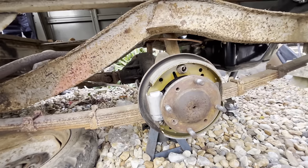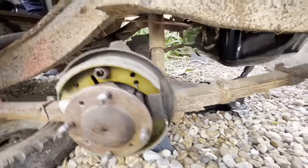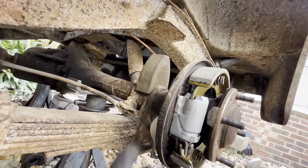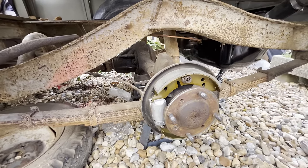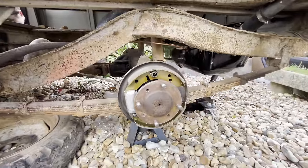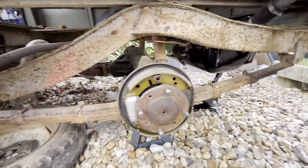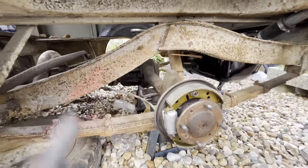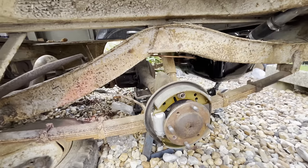So that's rear near side set up back on. Springs in behind. Just got to put the handbrake linkage back on there - it pulls on that. This is all nice and free which is good. That just slots in - I had to tap it in with a hammer just a little bit to get it to pop in there. And the rear springs that hold it to the back plate keep it all in place. Drums don't take too much really, once you know. You can just get in there with a screwdriver, lever stuff about, just make sure your springs are in the right place. And as I said, if you've taken a picture of it before, you'll be all right.